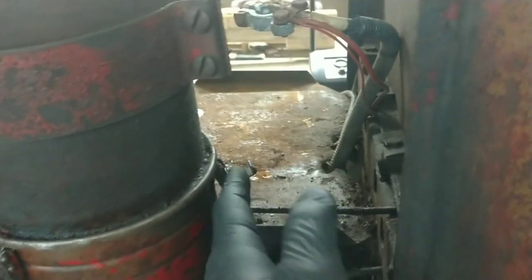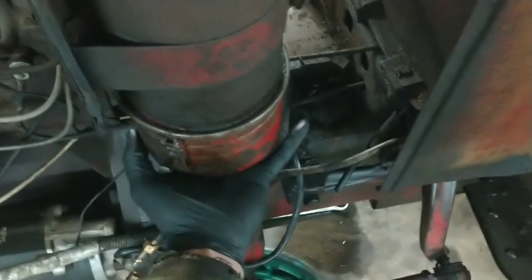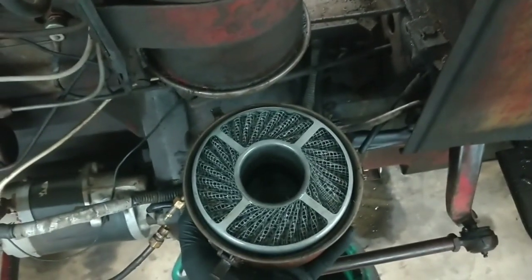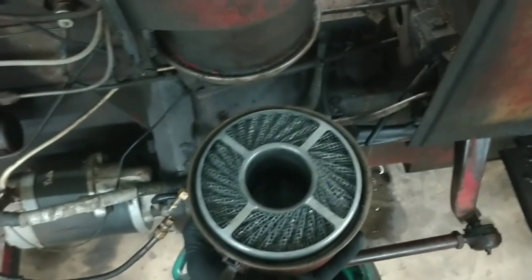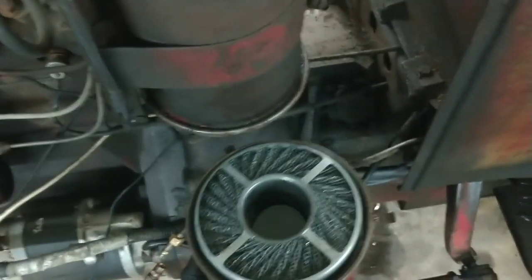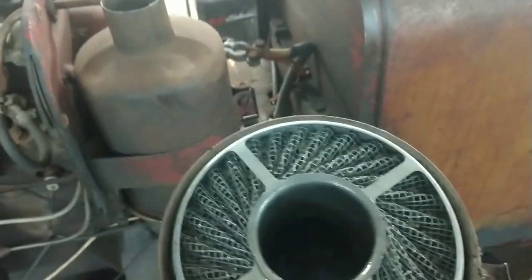Make sure your little triggers are off, and give it a shake. Usually doing this two-handed. I just cracked this thing loose — you should see what comes out. There's your filter screen. Air travels down the center, through the oil, and the clean air comes up through these mesh pleats. I did extensively clean this thing last year and I'm super satisfied with how it looks now, since we put several dusty hours on it.